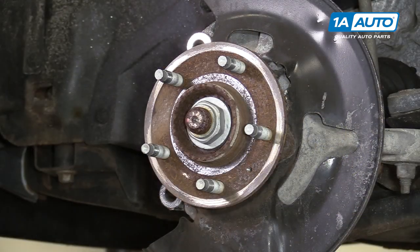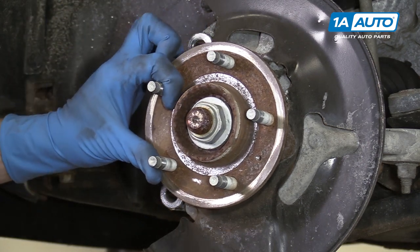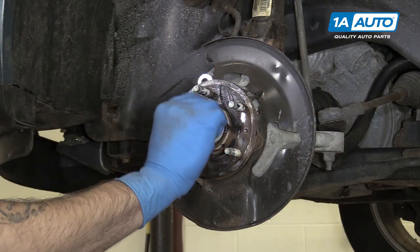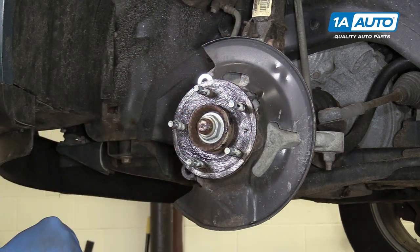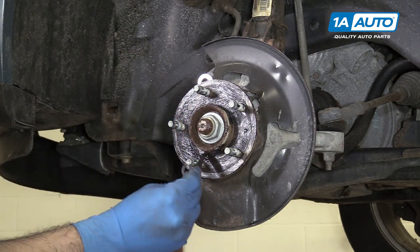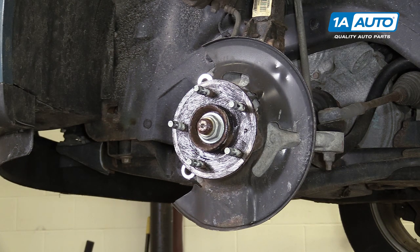Using a steel wire brush or some emery cloth, sandpaper, or something like that, remove the rust buildup on the face of your hub. Clean that as well as the center bore to make sure that there's no rust buildup that'll make our rotor sit unevenly or freeze on prematurely. Once you've removed the bulk of the rust, we're going to apply a thin coat of brake grease to the face of the hub as well as around the center bore of the hub. This will make sure that if we ever need to remove our rotor — whether it's an axle, a wheel bearing, the spindle, or something else — that it comes off easily and doesn't require a hammer, making sure it's removable and reusable down the road, as well as making future brake jobs easier.